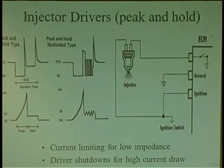Do you know that when a computer gets all these tasks of grounding solenoids, relays, it also has to ground circuits that draw a little more current, such as injectors. Injectors, especially low impedance injectors, can draw a lot of current. They can draw as much as 4 amps. So what they do is it takes more to open the puppy than it does to hold it open. So it's the first initial pull, right? It'll ground it down here. It pulls it up. See, now look how far it's grounding it. That's 4 amps. Then it kind of releases it to another level to hold it open.